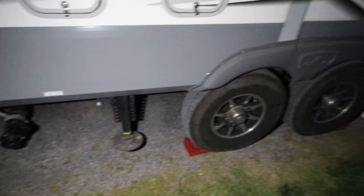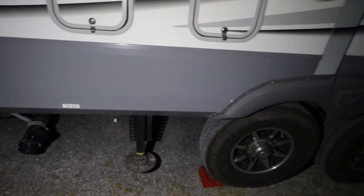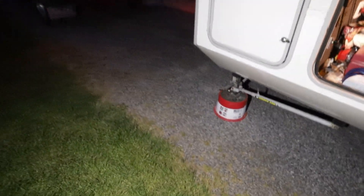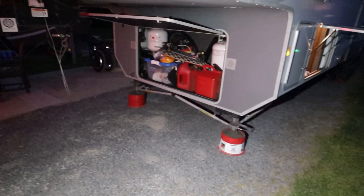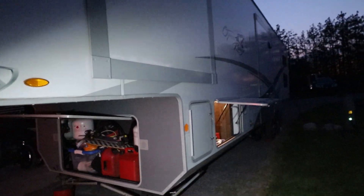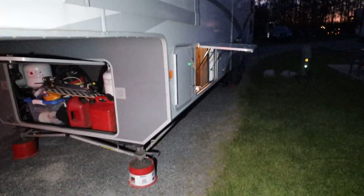So I'm going to leave this one up — it should be fine. There are a lot of RVs out there that only have four jacks. We have six just because we're a little bit bigger, but we're still fully sitting on our axles. The axles and springs are not off the ground — the RV is completely sitting on them, so that should not be needed. I started messing with this one because it looked like I was a little bit high on the left, so I started raising it. I never could quite correct it — it was always just a little bit off. I wound up a little bit nose high, but not too bad. We're just going to live with it just ever so slightly nose high.